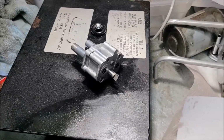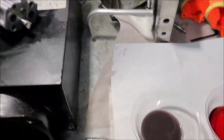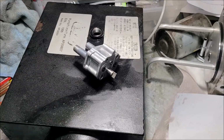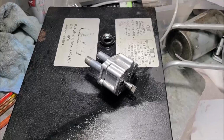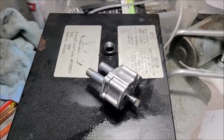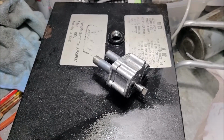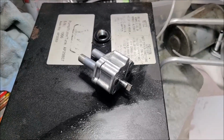So we need to be thinking about that, how to check our oil, examine it, see what it looks like, give it a comparison. Now, on my RV, I went back and looked at my notes. I did change my hydraulic oil, but man, it's been 10 years ago. It's when my shuttle valve went bad, and I pumped all the oil out of the tank. And that's another thing I've been trying to experiment with. It's kind of a pain getting the oil out of these tanks. So I'm going to try to come up with an efficient way for us to change oil. So that's going to be in my next video.